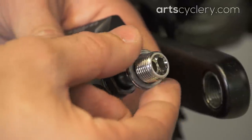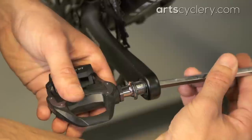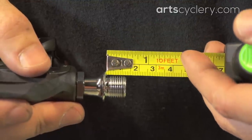A narrower stance is good for riders with narrow hips. You can add more than one pedal washer to your pedals to better fit riders with wider hips, or use more washers on one side than the other to compensate for body asymmetry. When using more than one washer, you need to make sure there's enough thread engagement with the crank arm — the minimum required is 11mm.